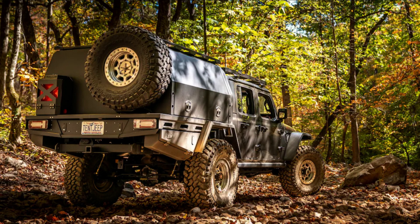On the trail, upgrading to the MITS Alloy tray and canopy is a major change, and one that we thought seriously about for some time. The extra width makes it a little harder to see around with our stock mirrors, but we love the added room. The fact that we can carry so much gear in a well-organized manner makes the bed way more usable than our previous setup. We did have to dial a few more turns of low-speed compression adjustment into our rear Fox 3.0 shocks, but the handling and ride quality are still excellent. At the end of the day, the EVO2 setup does exactly what we were hoping — it provides more room for our gear and greatly improves the off-road shortcomings of the stock Gladiator bed.